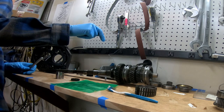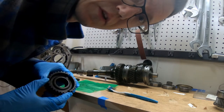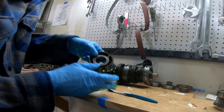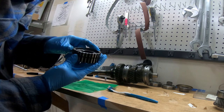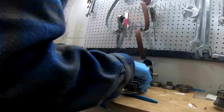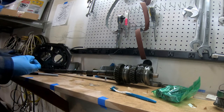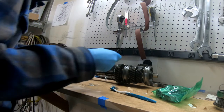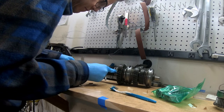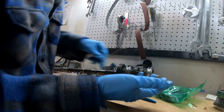The factory service manual says to pay attention to the insert retainer's direction, and I didn't necessarily do that — so let's hope that doesn't come back to bite me. I'll be able to figure it out. I hope I took enough pictures. One side is shiny, one side is dull, so we'll hopefully figure out why it's the shape it is. Notice that this washer has a little hole for a ball. There should be a ball somewhere along here that I unfortunately don't see.